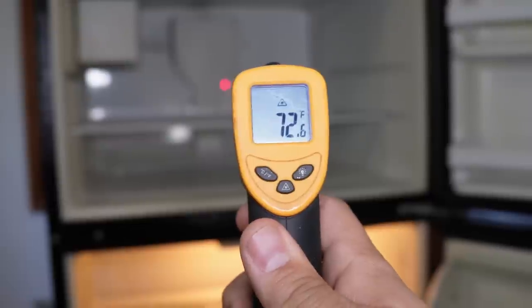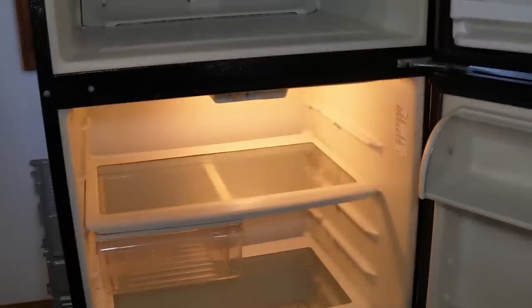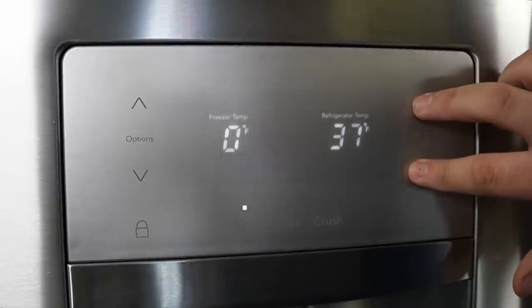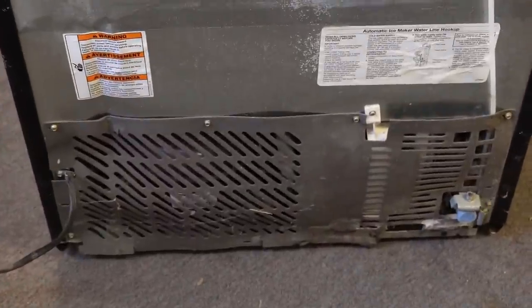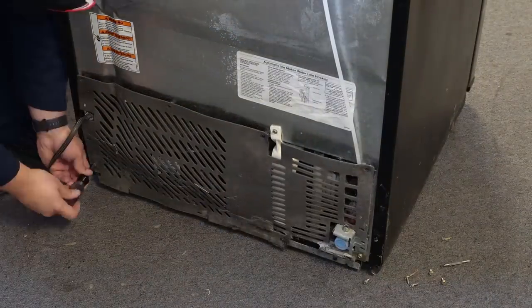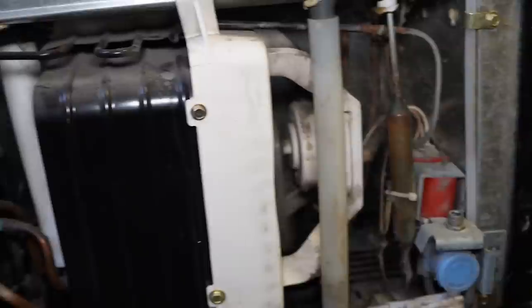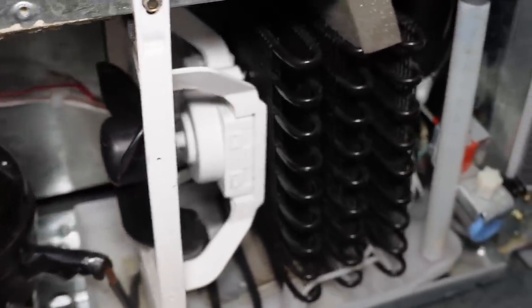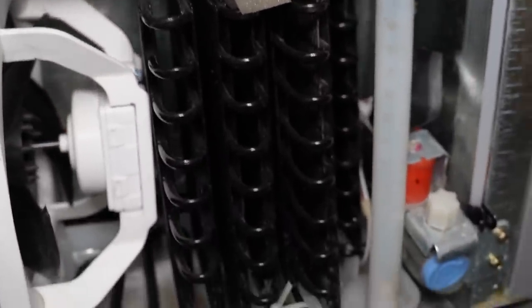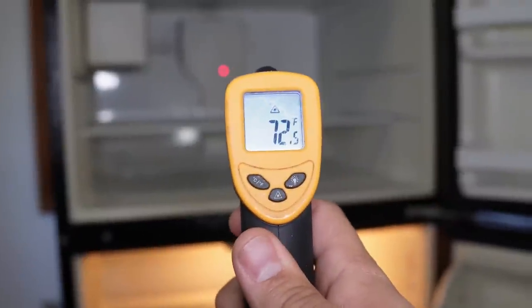It's one reason you may want to ensure there's a 30-day warranty or at least know that the unit's been plugged in for a few weeks. If you know how to force the unit into defrost using diagnostics, that would be a perfect thing to do. Another thing to look at when inspecting a refrigerator even if it's not plugged in is the panel behind the unit at the bottom, which usually contains the condenser coils and compressor. Are the coils dirty or damaged? Dirty coils can cause a unit not to cool properly. However, if I see a good newer refrigerator with immaculate coils, I actually get worried — it often means someone has cleaned them out because they're trying to get the refrigerator to work.